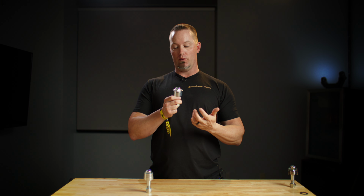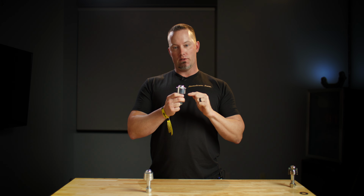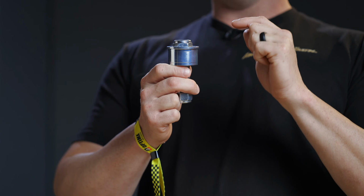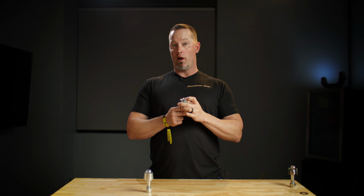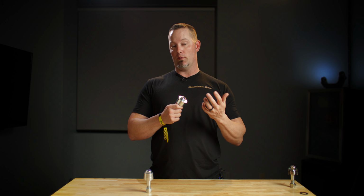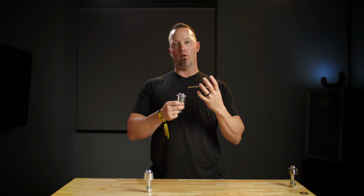Some of the benefits of a rebuildable joint is you're not paying for a whole other ball joint when you don't really need a whole other ball joint because you don't need to press it out. So a rebuild kit comes with all the internal pieces that you need. For each joint, you have a spherical, a C-clip, a seal, a shim, and new nylocks. That process is about twice as fast as actually pressing out an old ball joint because the downside of replacing joints is pressing out the old joints. When you press out old joints, the C hole actually loses material each time. So each ball joint that you put in has to be incrementally larger because you're actually removing material from that C when that old ball joint comes out.